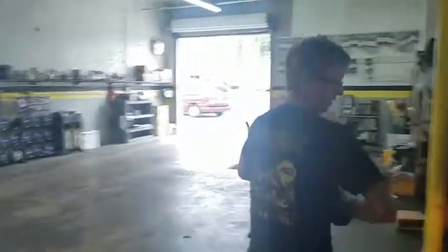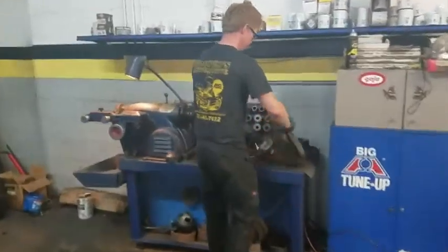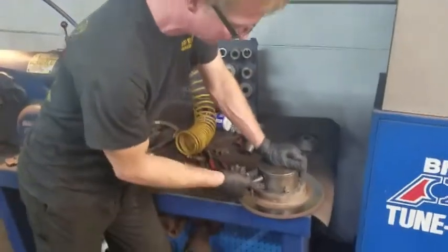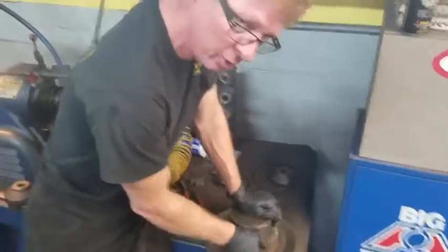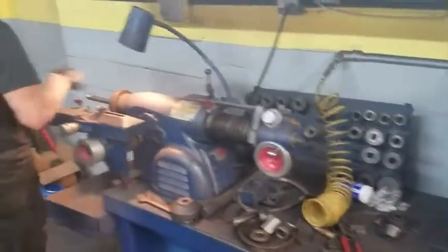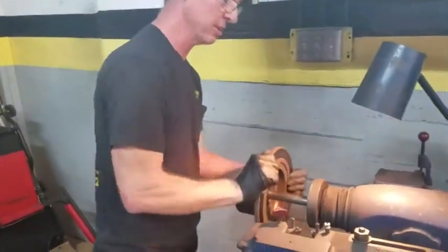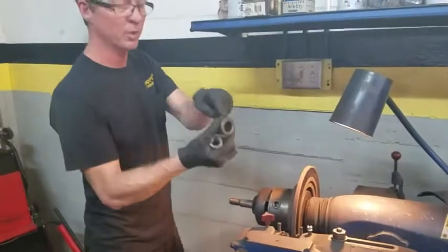Follow me over to the brake lathe. Here's what I do — this adapter fits so many different rotors, makes it a lot easier. Put that on there and go around it with a chuck just like you would on a drill. Make sure that it's tight. Then you've got your inside piece that fits. This is an old Ammco 4000 brake lathe — these things work forever. You've got to take the space up on the arbor; always put the piece with the little rubber anti-chatter on.